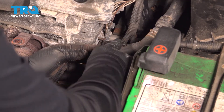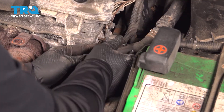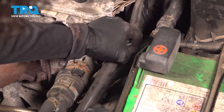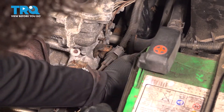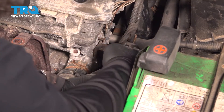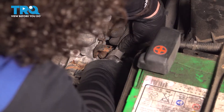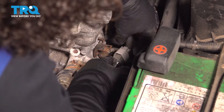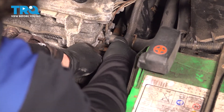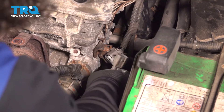Now, this one has been busted, but there's a plastic tab right there. Take a small screwdriver and lift up on that plastic tab — once it's pushed up, you should be able to slide it off just like that. That exposes the connector easily. Now we're going to push down on the tab in the back — that's the locking tab. Push down with your thumb and disconnect it. There's a lot of dirt in these through the years, so it could be a little fight.